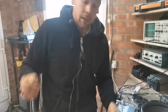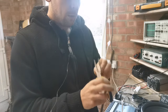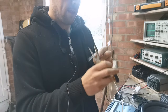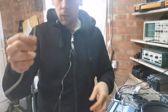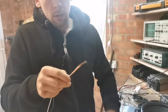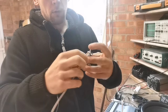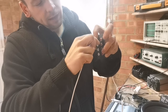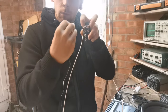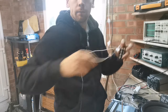If the problem is with your head unit, what you can do is get a piece of wire — any wire, about two millimetre wire is plenty good enough — and you want to strip quite a large amount of wire from the sheathing. Then you take your RCA ports on the back of your head unit, twist the wire so it all stays together, and wrap it in a figure of eight around the outside. When you plug your RCAs in, it will clamp the wire to the shielding.